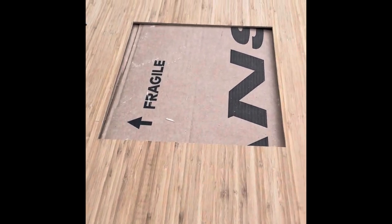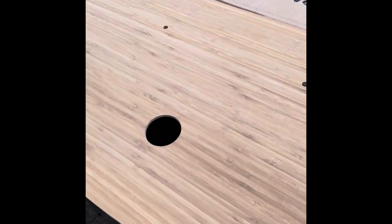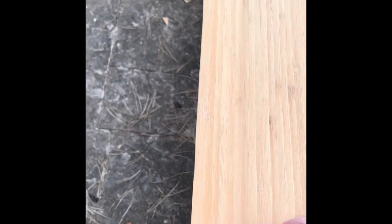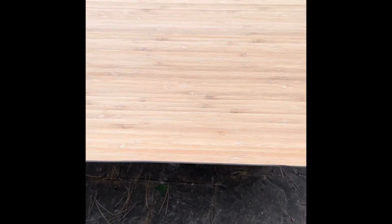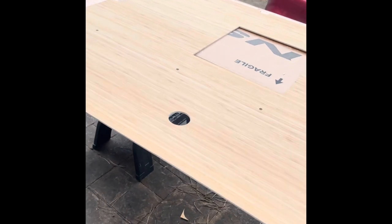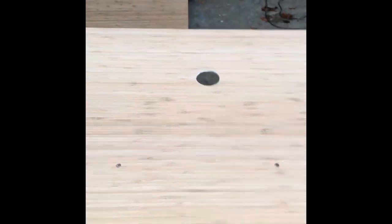I marked out when I was up on top of the roof, came down, flipped the panel over, and cut out the opening for the Maxxair fan. I've also cut out the first hole for the downlighter, so that's the front panel done. I've had to take about 35mm off this front edge because it's designed for use without a bulkhead, but I'm utilizing the bulkhead that was there. So I've trimmed it flush so it will butt up neatly against the bulkhead and the upholstery.